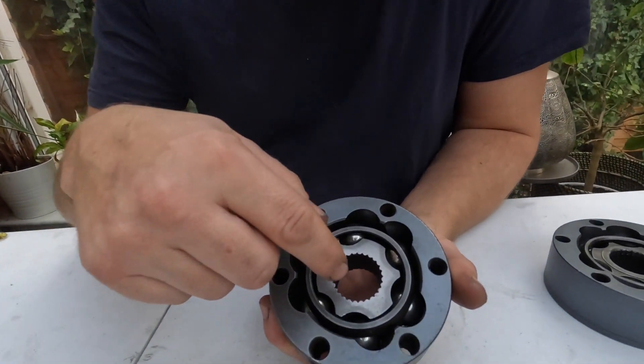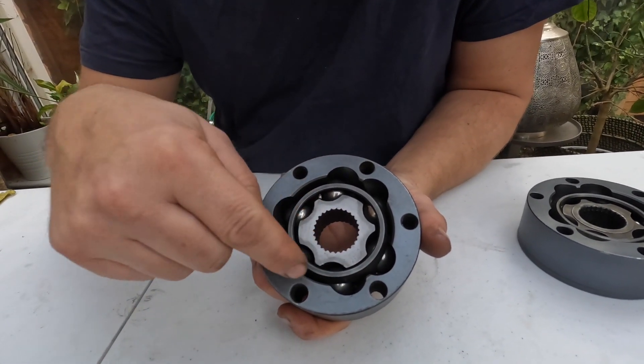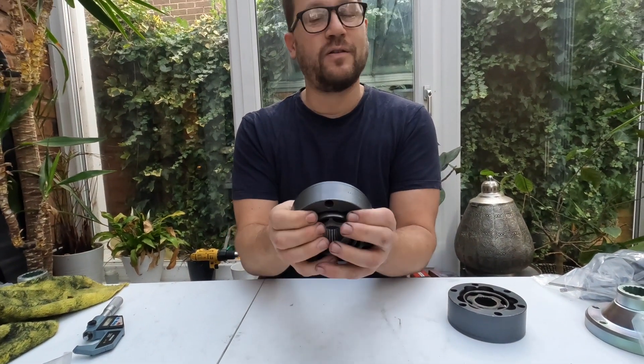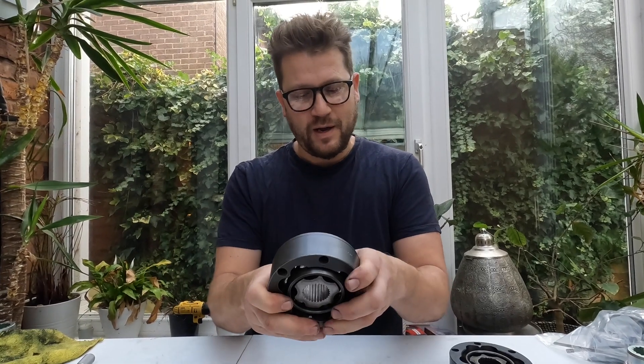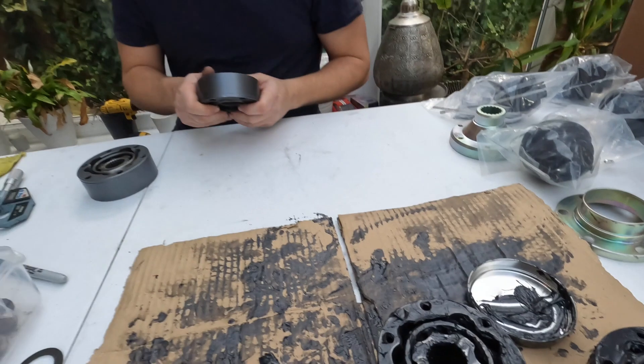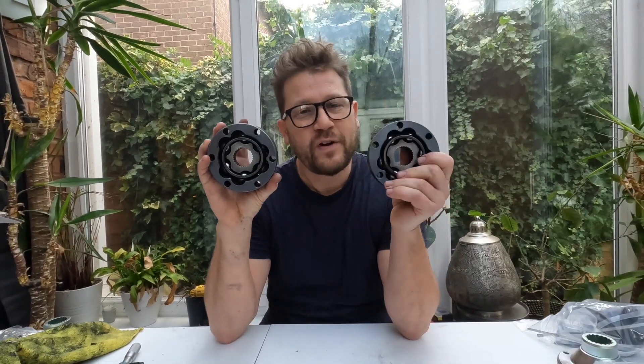What we were supposed to do is match up the big area with the small area, and the small area with the big area. Once you do that you've got much more movement — and bear in mind this has no grease on it at all. The previously greased ones had very little movement because the centre section was completely rigid, meaning when you've got a shaft connected to the engine, there's zero articulation — major problems down the line. I was doubting myself, researching online, couldn't find much, then luckily found a video and immediately remembered what we'd done wrong.